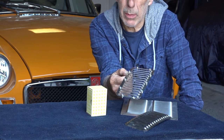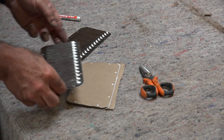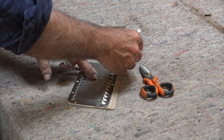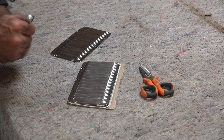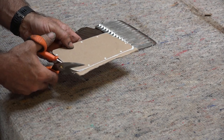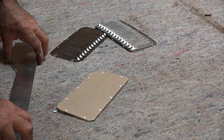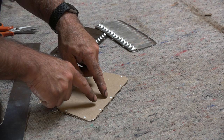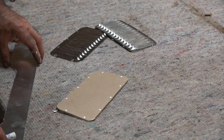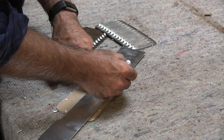The next thing is to build the template. All you need to do is place your louvre onto a piece of cardboard, mark it, and cut it out. I also marked where the bolt holes will come. I want to cut the piece out of the bonnet which is not the full size of the louvre — otherwise the whole thing would fall through — but about a centimeter less, so I have sufficient space on left and right of these holes.